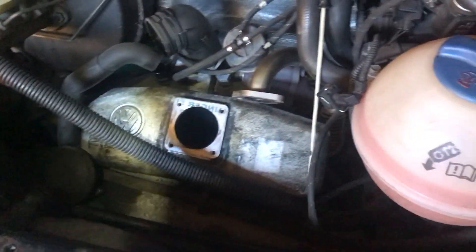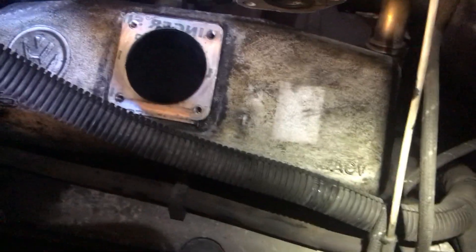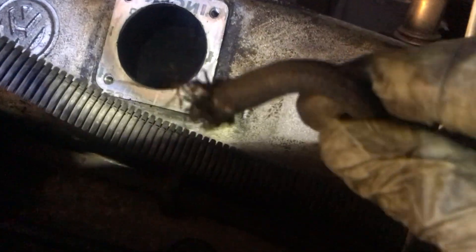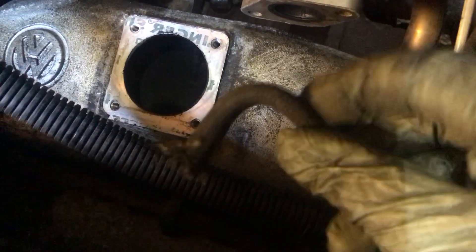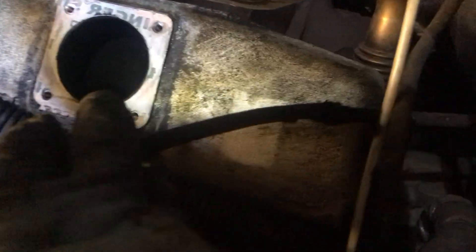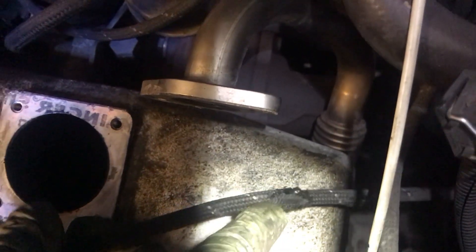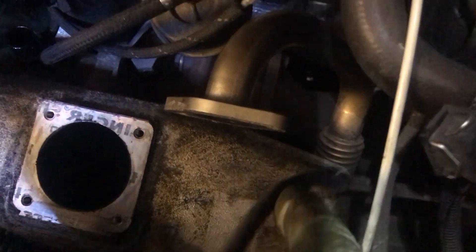So far what I've found is similar to other people. These rubber hoses — rubber vacuum lines — one here has a braided cotton cover, and they are well past their sell-by date. You can see this one here has got some wear on it; it's probably not gone through yet, but it's not long until it does form a vacuum leak.